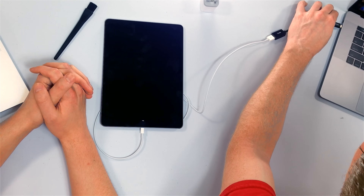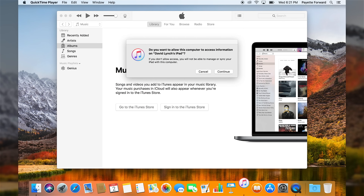Next step: let's say the charging port is clean and the iPad still won't charge. We've addressed the main components of the charging process. Let's try plugging it into a computer. If the iPad shows up in iTunes, it means there's a problem with your iPad's display — it's not that it won't charge, it's already charged and on; the screen is just black and not working. Back it up — you probably need to get your screen repaired. If it doesn't show up in iTunes, you can still try to put it into DFU mode.